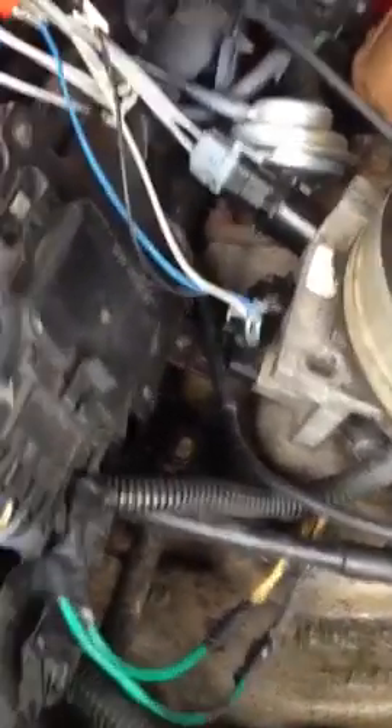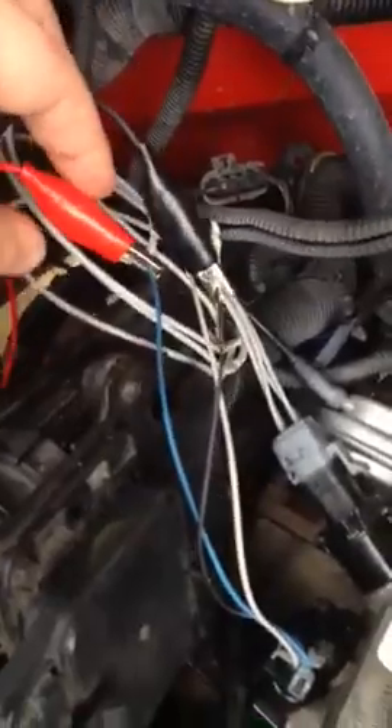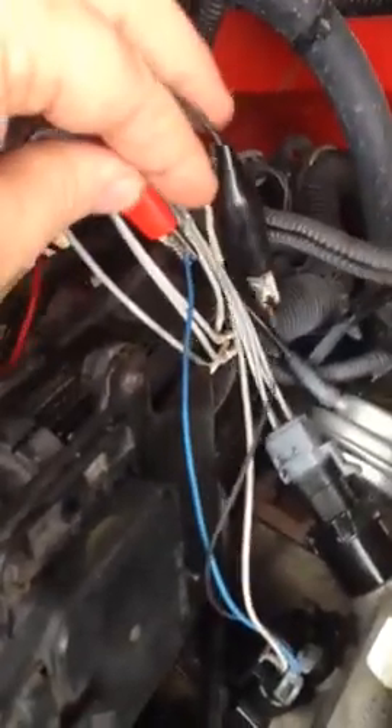The way you can check and see what your throttle position is, you can hook up — I had freshly soldered wires, I keep them separated — and then you can put alligator clips. The positive is on the blue wire. The negative goes on the black wire. I'm not sure what the white wire does, but you don't hook up to that. Then hook the alligator clips up to the electrodes for the voltmeter.